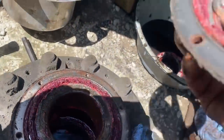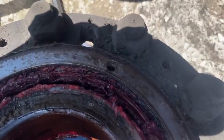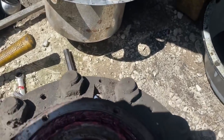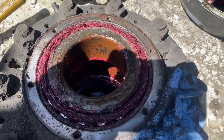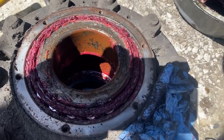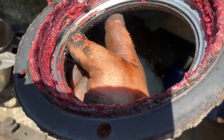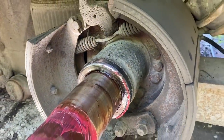As soon as the screws were out, this retainer just lifted right off. And I'm thinking that's probably where the water was actually coming in at, because I see kind of a little rust coloring underneath where the gasket would have been. And that really shouldn't be there. So my guess is that that is where it was leaking, because the seal is one of the ones that turn on the inside of itself. And the wiper looks pretty good on it.